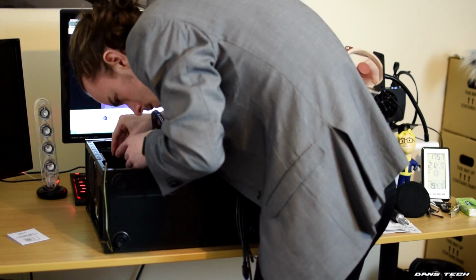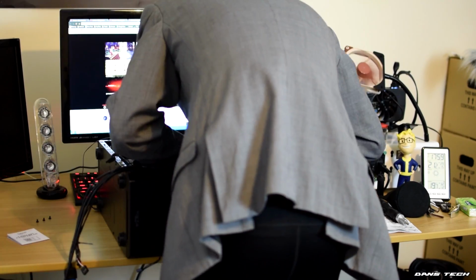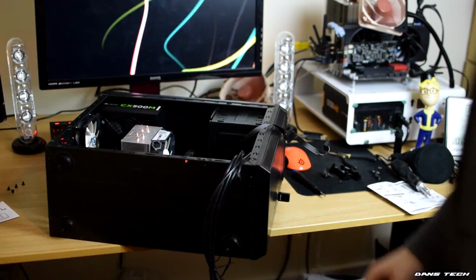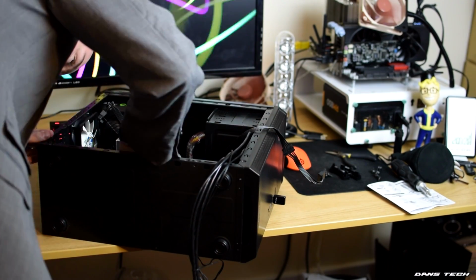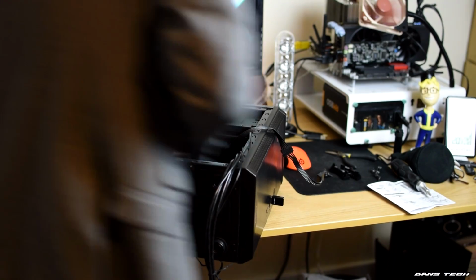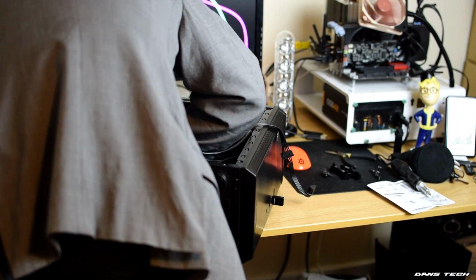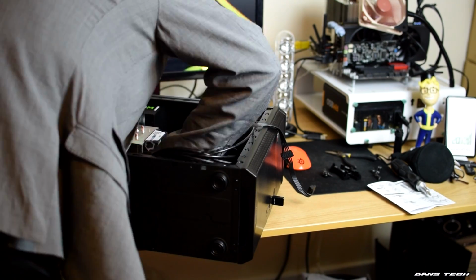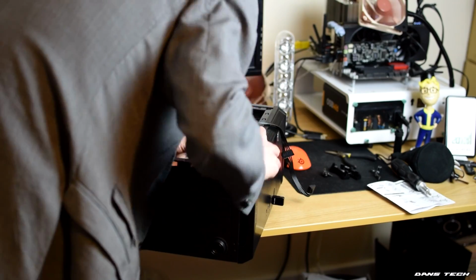Now I hope this video has been useful, and if there's a most useful tip I can give you, it's to find the loudest fan inside the computer and replace that. In my sister's computer, as mentioned at the beginning of the video, the loudest fan was the one on the AMD stock heatsink. That's why this did indeed get swapped out in this project for the Arctic heatsink and fan. Now if the case fan is the loudest component in your computer, then simply upgrade this and it'll be a simpler and also cheaper project for you to perform.